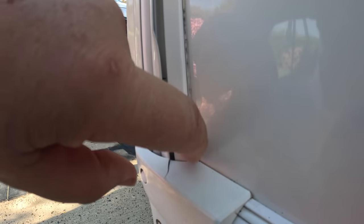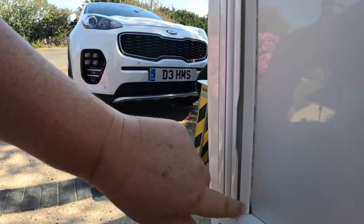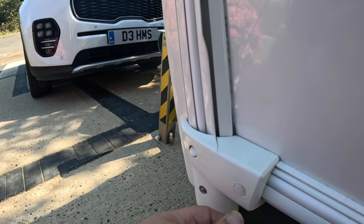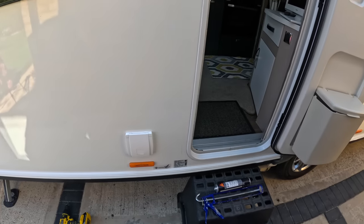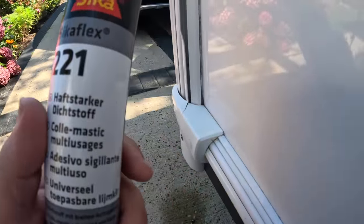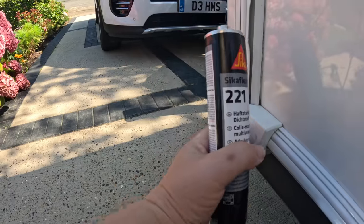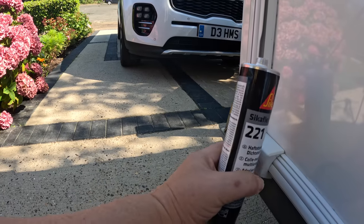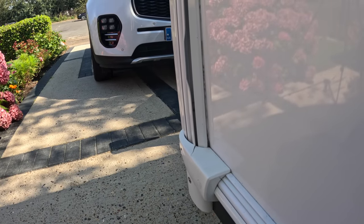What I'm going to do is take this bracket off, try and pull out some of that old sealant, give it a clean with a bit of white spirit and then reseal it and put the new bracket on. I think when the bracket comes off the screws will almost certainly have a whole load of Sikaflex sealant. So we're going to use some Sikaflex which is absolutely the stuff of the job for caravans, motorhomes, boats. That's what we need to be resealing this area with - get a load of Sikaflex around the holes where the screws are, reseal this and get it back on nice and tight. There's also a little crack in this side here as well. Not a big job but I hate getting this stuff all over my fingers.